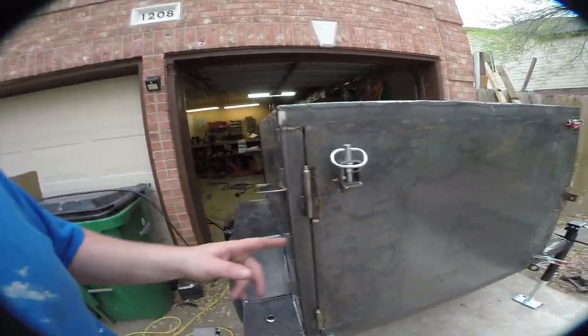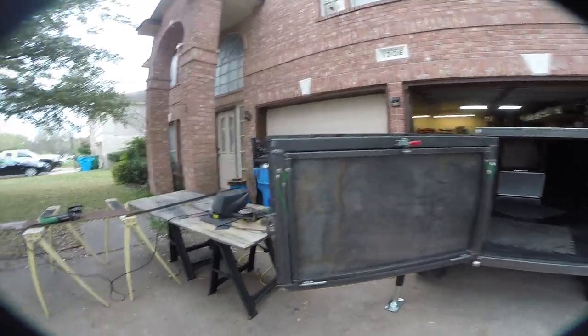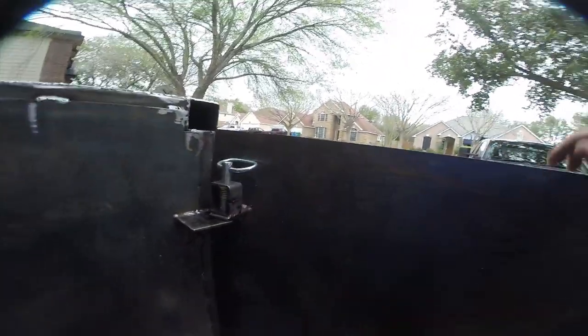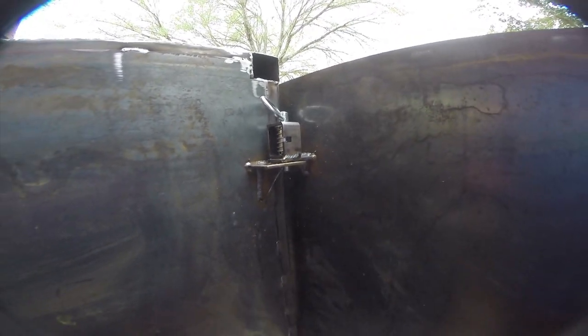One of the little things we had to take care of while this was outside is this mount right here. Basically whenever we open this to set up camp, you swing this open, and if it's on a hill it's gonna find its own position — and that's a lot of mass swinging, which is not good. When this table is down I want it to be rock steady. So this goes like this and then the pin shoots through — we triangulated on both sides, this is probably quarter-inch material. Now there's a little bit of play where the pin is slightly oversized, but this isn't gonna shut on you and potentially hurt somebody. When you're ready to go you just yank it up, twist it — it's all kind of a one-hand operation.